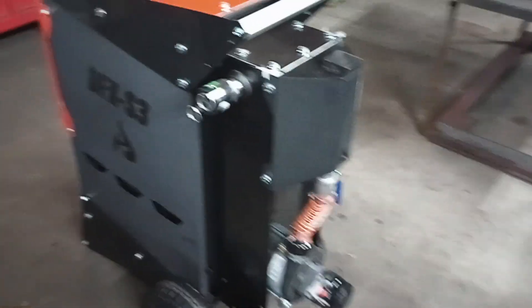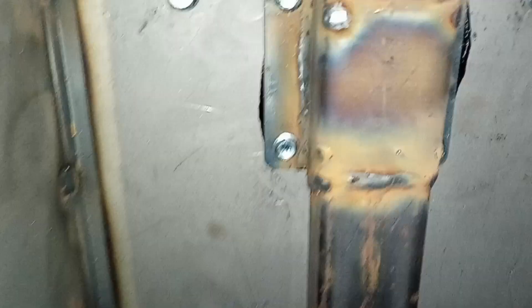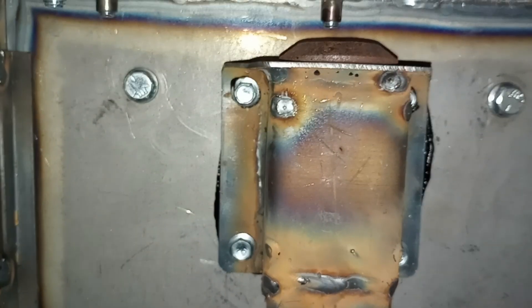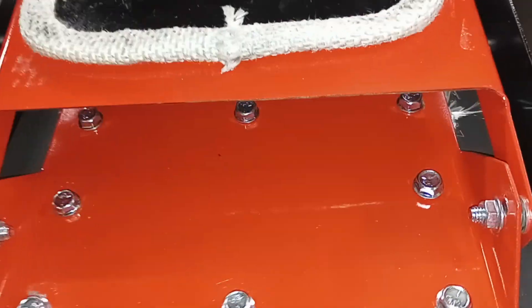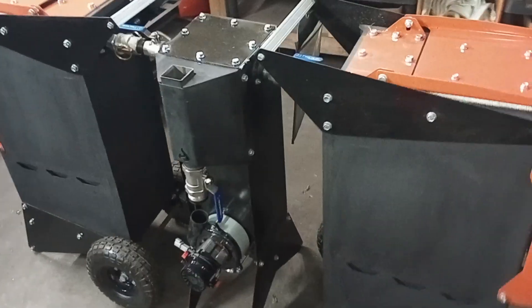When you separate the Fusion from the gas fire module, this port is actually built into the pickup tube. This is one of the pickup tubes on the 2023 model — as you can see it's already got a port adapter built into it. From the inside, that's the pickup tube and you see the port on top — that's your clean-out port. Remove the access cover and you'll have access to clean that tube out if you ever need to.